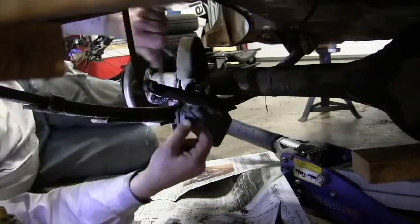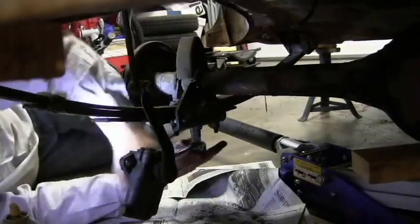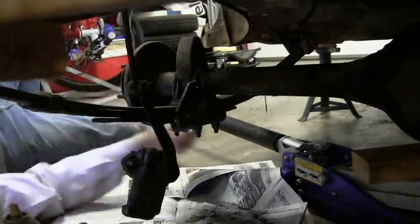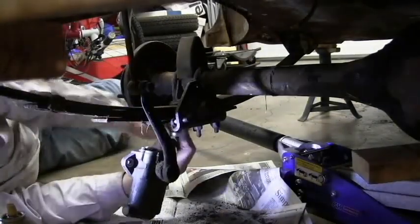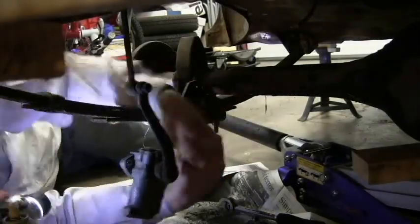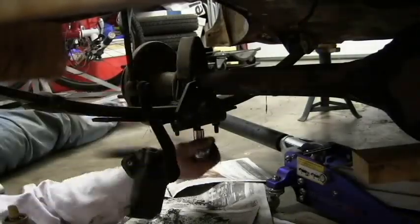Removing the rear axle was relatively simple. I was taking everything off the car, so the first thing to do was disconnect the brakes. At this time, I think the petrol tank was out. The prop shaft was still connected to the axle. It was a question of undoing the U-bolts underneath the bracket, getting the U-bolts out and the bump stop, and then the axle is free.